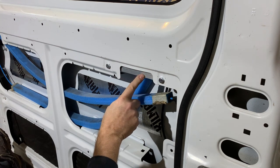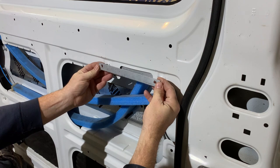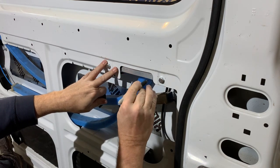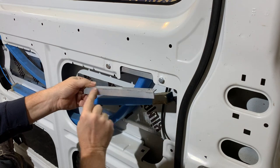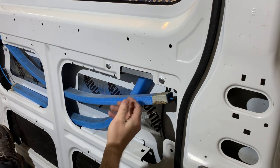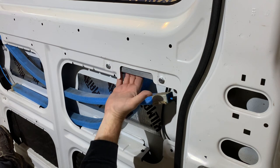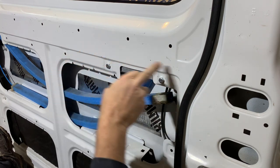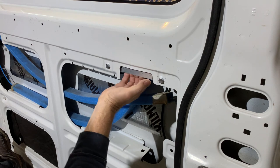Here's the reinforced backing plate I made out of aluminum — it adds a lot of integrity. The bracket visible on the outside is what I'm tracing here to find where to leave the handle portion. I'll cut off portions of the visible piece but leave the handle so you can grip in behind it. On the back, I have to cut a hole to put your hand in, and I'll have a little piece of aluminum hanging down, riveted to the back piece, fabric covered. Visually, you won't see anything except fabric with a little notch to put your hand in to assist in closing the door.